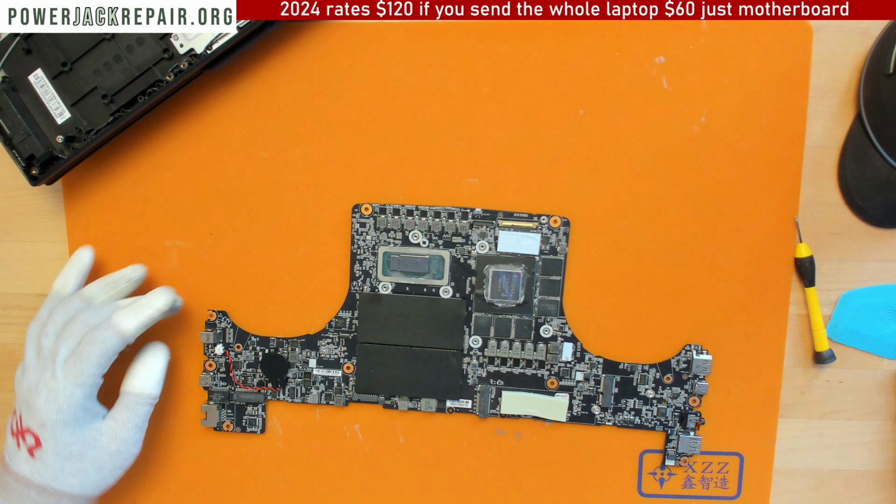All right, so here you want to put some solder right here because that's the ground we got here. For stability purposes and for ground purposes, this is the ground. We want to put some. I just can't see that far in here. All right, you want to solder this end here. Like that, okay. Let me show you under the microscope how it looks.